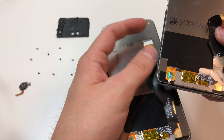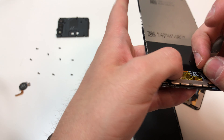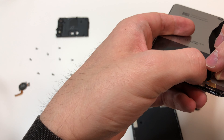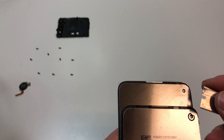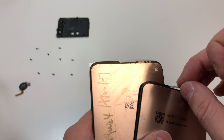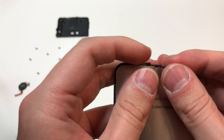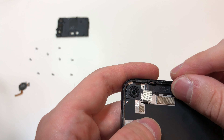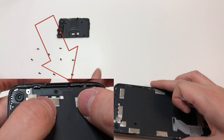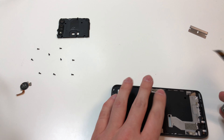Move all the components from the old screen onto the new screen — move over what looks like it needs to be moved, like the little cover over the flex cable. There's also a little ring that prevents dust on the front camera, but it was too difficult for me to remove. Then there's the earpiece — rip it off, it is glued on so it might be a little difficult. I recommend gluing it onto the phone rather than pulling off the tab on the side like I did, because that's what holds it in place. If you do that, add a little bit of super glue under it and it should stay on fine.